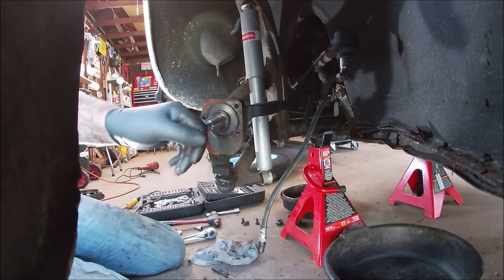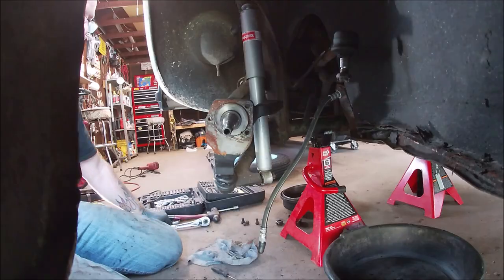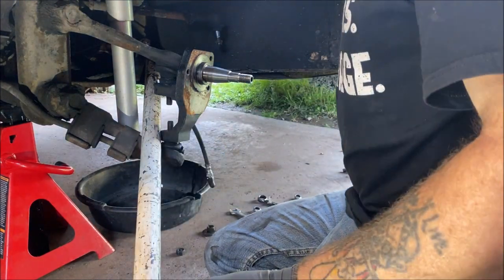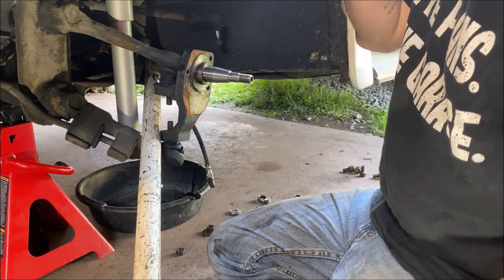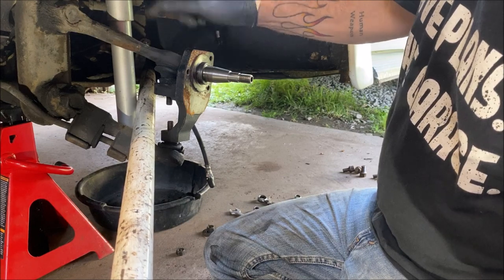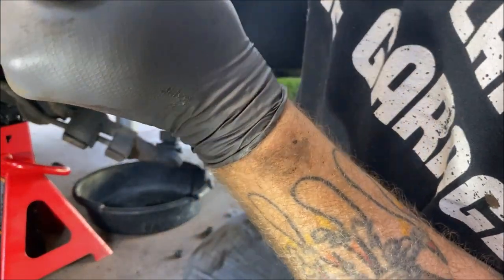And there is a washer on a stop one, as you see there. Boom. Okay. All right. Okay, so now we're going to turn this the opposite way. So let me move the camera. What I did here, I took a long bar, which any type of bar will work, it doesn't matter. And I got it wedged in here, and I'm going to pry up on the ball joint, the control arm. Hopefully I'm not in your way. I probably am.